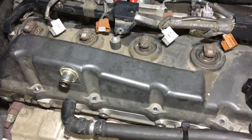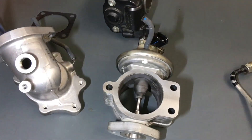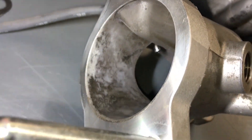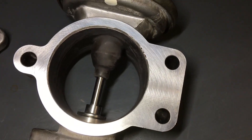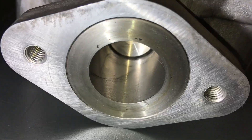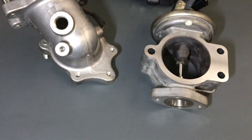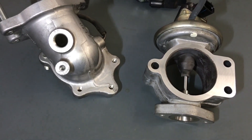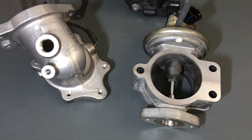We're just demonstrating the major differences between the Hi-Ace and the Prado and the Hilux. We gave it a quick clean — the carbon clean residue makes it really hard to clean off the surface. At least we know it's clear. We were joking around about leaving it blocked, but we said what would we do if it was our vehicle? Clean that out, clean out the end of the EGR cooler so it can breathe, and then put a plate in. We have a feeling the customer's got one — could even have one in there already. It'll end up with a plate in there because that's what people do, and it'll reduce the flow.